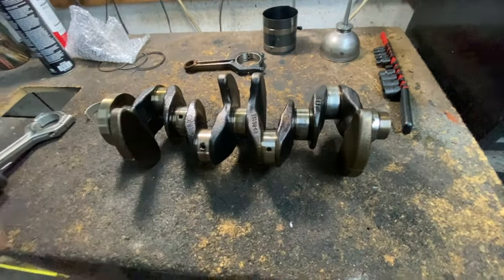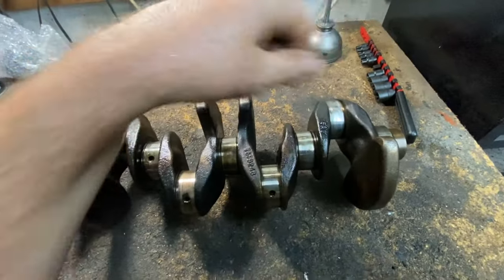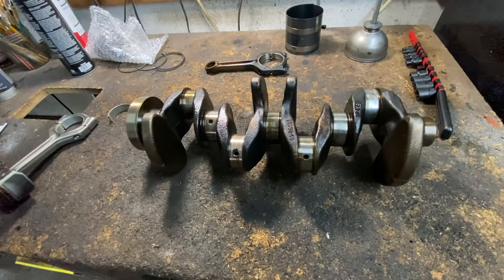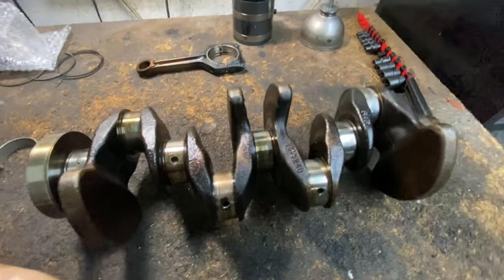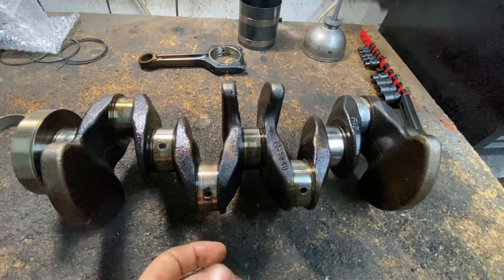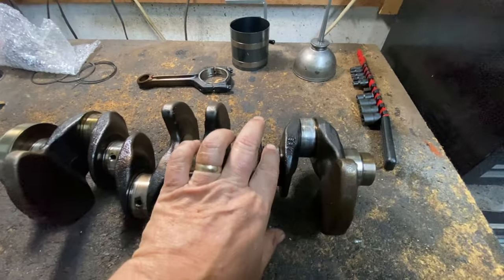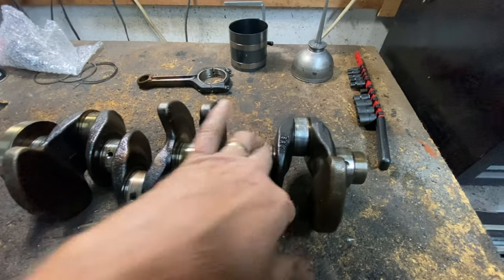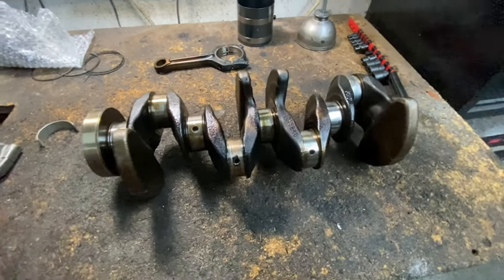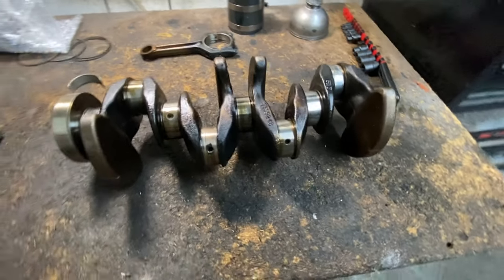You could do that — see how much that costs. But basically you cannot just drop the oil pan, take it off, and clean it up. That is not a repair I recommend; it's not going to last long. These things are perfectly machined to very tight tolerances — thousandths of an inch. If you try to do something like that, you may start the engine and it may just seize right then and there again. That would be a very poor repair, so that's not really a good idea.